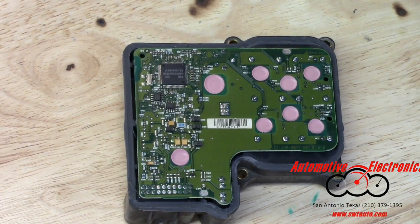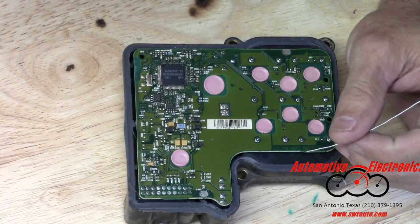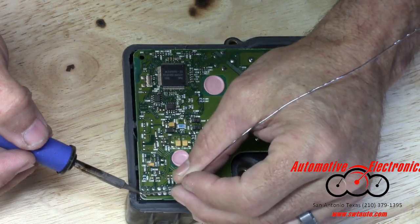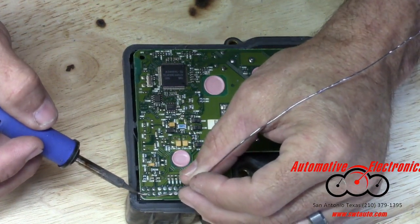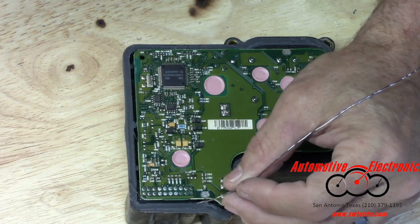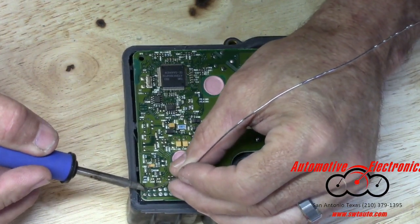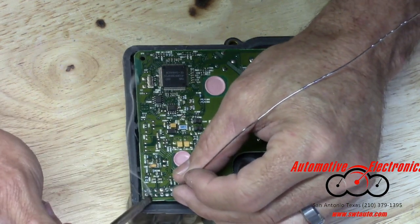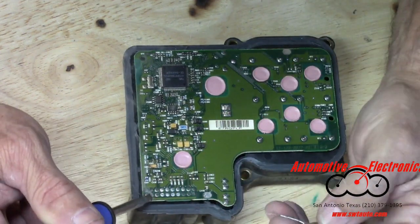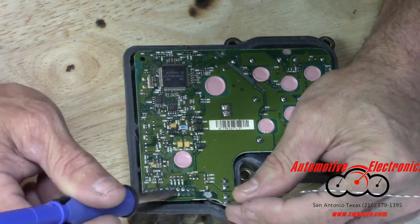This is something you don't have to solder underneath the microscope — you can probably do it with your eyeballs. The repair process is not real lengthy. You just go over these pins once your iron heats up. Normally a little delicate iron is good for most of the electronics I work on — that's my go-to. But if you want a little more heat, get a little thicker chisel tip. You can get a little more heat on it, which makes your work go quicker. Thicker connections sometimes require a little extra heat.